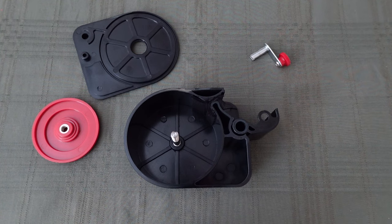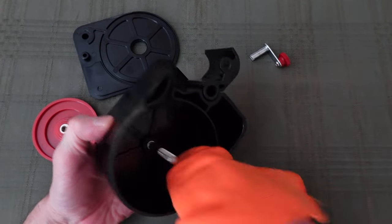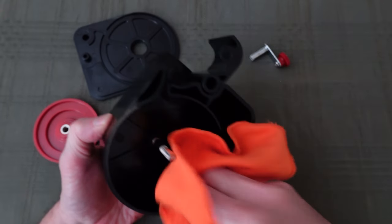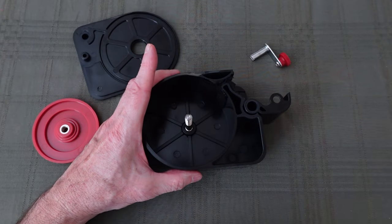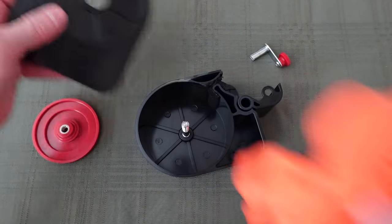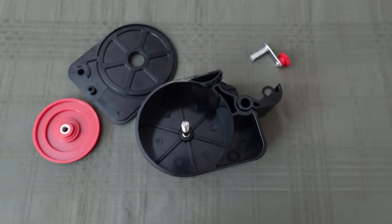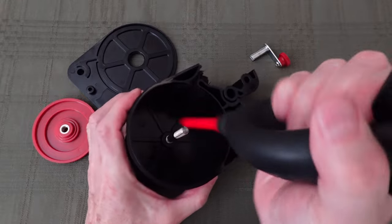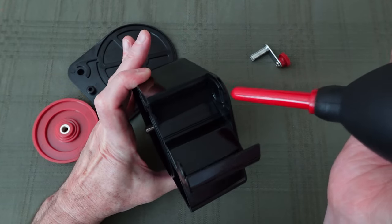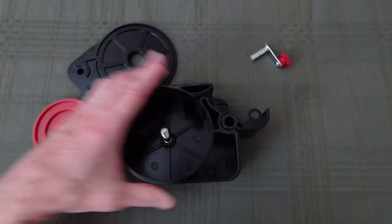What I do first is make sure there's no issue with dust or small particles of dirt. I start with an anti-static cloth and rub around the inside of the film chamber. That helps remove any static charge that might be in the chamber, which would attract dust, and it also helps clean dust out. I do that for the lid too. Then I follow it up with my rocket blower and blow air into it along the felt, and even where the cassette goes into the front, I'll blow some air there. The object is just to keep the film transport clean.